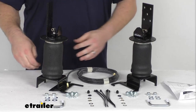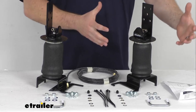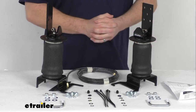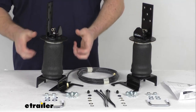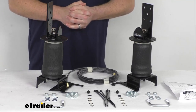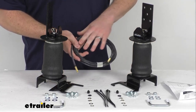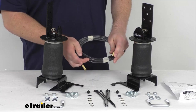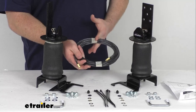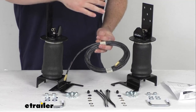It's going to give you the support you need to level your vehicle front to rear. You can also inflate each spring independently for side-to-side leveling. If you have an off-center load like a big tool box on one side of your truck, you can air up that spring more for extra support on that side, while the other side is inflated to whatever pressure you need. These have a manual inflation setup and come with the tubing you need, typically mounted on the bumper for easy access. You cut the tube in half — half goes to each air bag — so you can air them up independently.